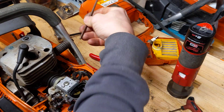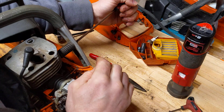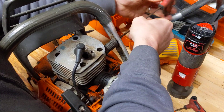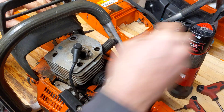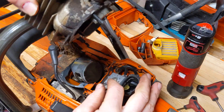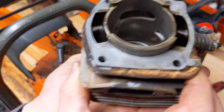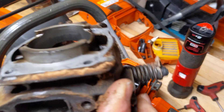There we go. All good — that's disconnected. The last little thing you need to do is this 4mm that just holds the AV spring on, so just disconnect that. See how much that cylinder's wobbling around about — hopefully any second now we will see the piston. So that all comes off, and there we go. Straight off. Let's get the cylinder bolts out. Last one out. I just keep everything — I think that air filter cover is a nice little compartmentalised box.